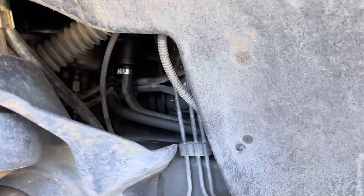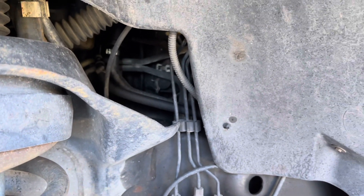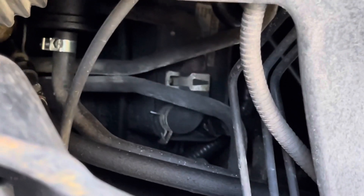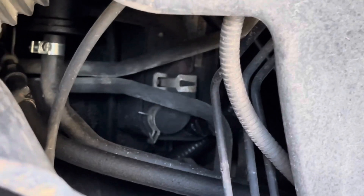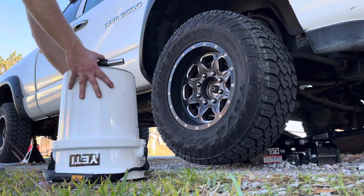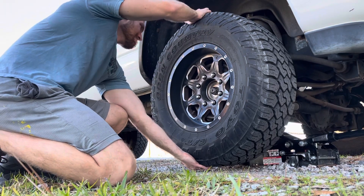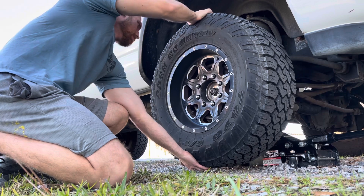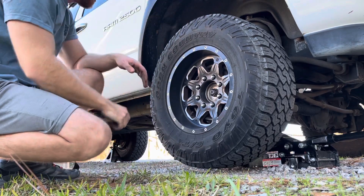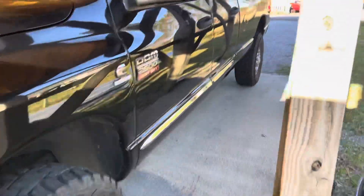I like to peek through here too — we're looking at a fuel pump, it's not dripping any fuel, that's good. Sometimes I get a little canister O-ring leak. And right through the middle there, that's your transmission heat exchanger if you've got an automatic — good to keep an eye on that, make sure it's not leaking. And don't forget, before you even take your tire off, do a grip at 12 and 6 o'clock and see if you have any play.